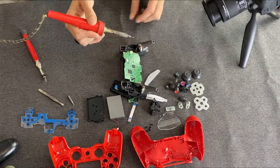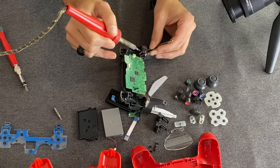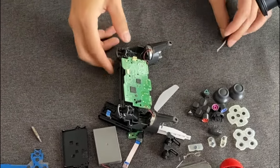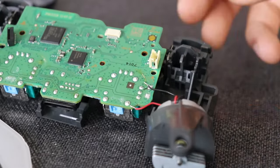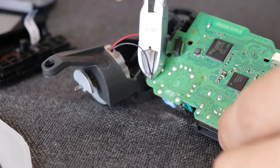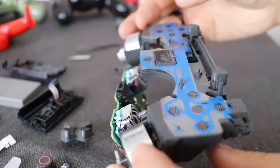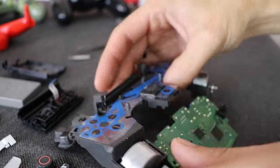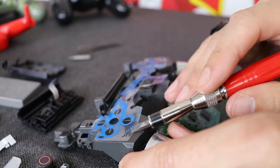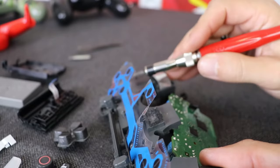The vibrators are soldered on the board. You can unsolder them using a soldering iron or cut off the wires altogether using a plier tool. The plastic conductive film is pretty sensitive, so be gentle with this one — don't scratch it, don't bend it, and don't tear it. Be patient with it and it will come off easy. The film is held in place by four plastic pins and the design of the internal plastic frame.